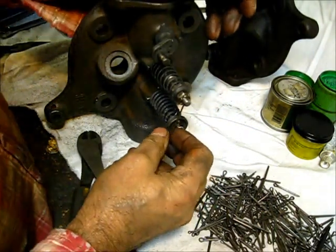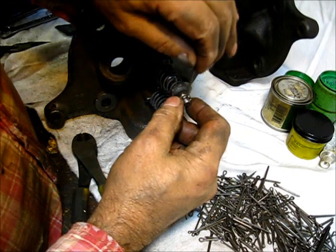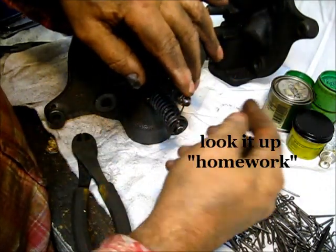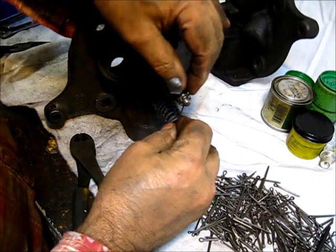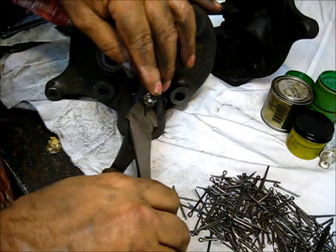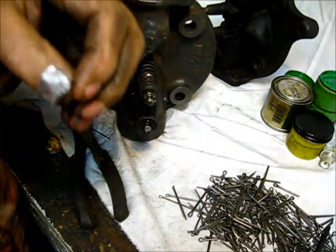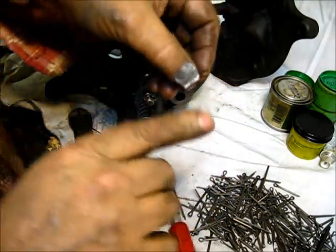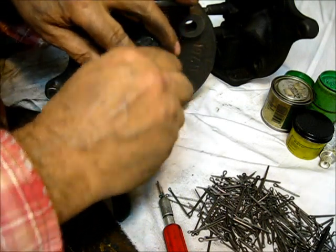Just put them in there — and see, that's wrong right there. A cotter goes in sideways and then the ends come this way and this way. You do not put a cotter in facing this way. Look it up in the book; do it right the first time. Snip that off, take a file and file that off rounding, then pry it apart. File those two ends rounding and you will not hurt yourself at a later time.